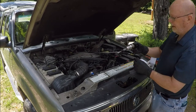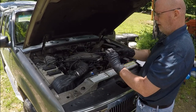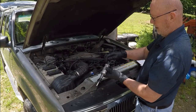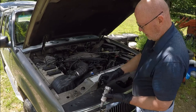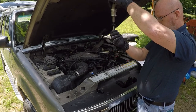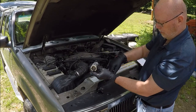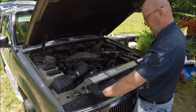So this will be your part, the camshaft position sensor. A lot of you can get away with just changing the piece at the top, but since it comes with an entire assembly, we're going to change the entire assembly. It comes with a special tool to align the gear, because the gear is worm-shaped. See? I told you. Your sensor. As you drop the tool in, the gears push in, so as this turns, it drives it in. Where the sensor would read for your timing, you have to get it in the correct position, just like when you replace a distributor.